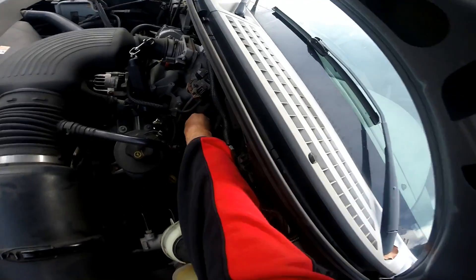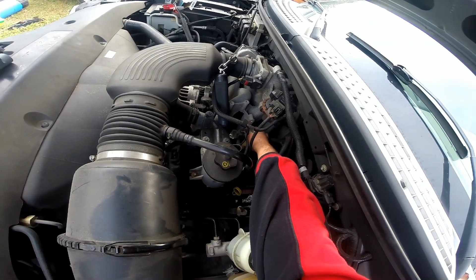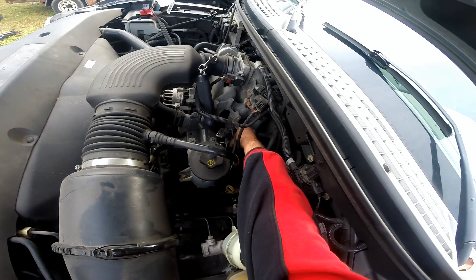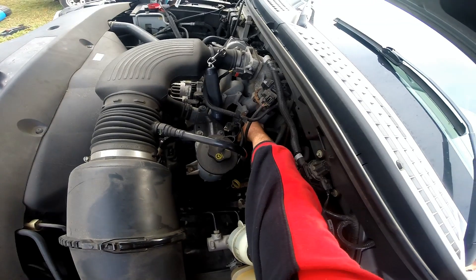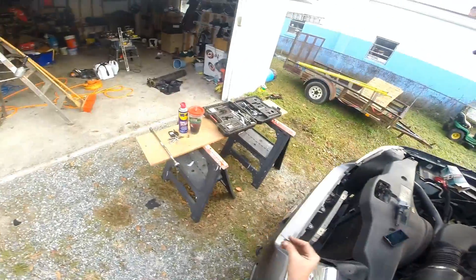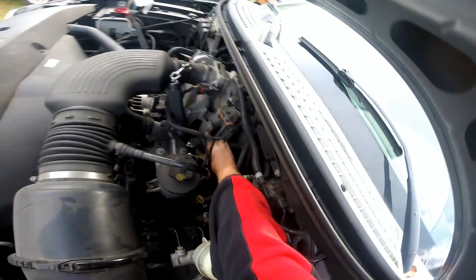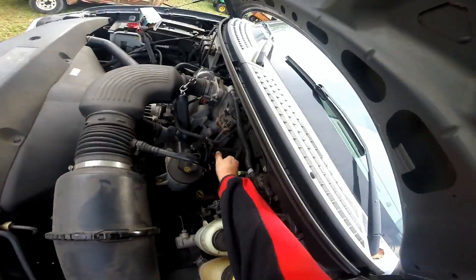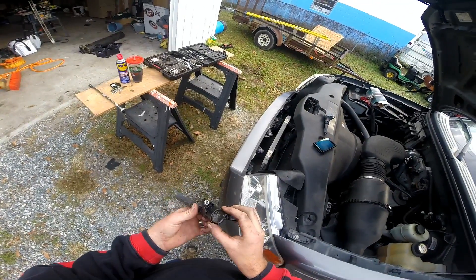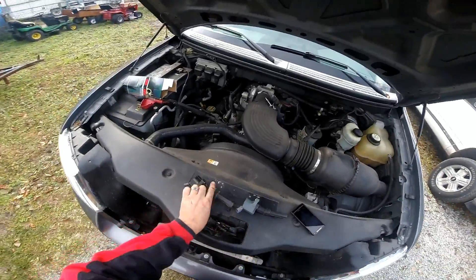Didn't have to take the fuel bar off - that's good. Should be loose enough to get it by hand. The key here is don't drop it. There's the bolt. The COP's ready to come out. And there it is - you can see some corrosion there. That's the bad COP. There's the old one next to the new one.